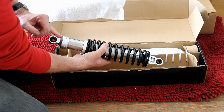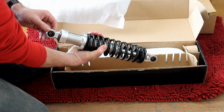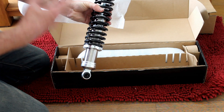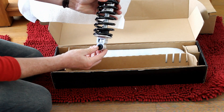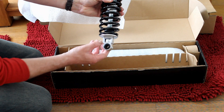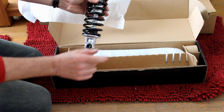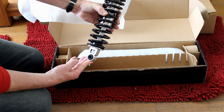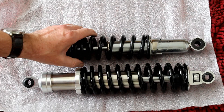The stainless steel spring in my case I had powder-coated black, the main core is also stainless steel, and these parts here are aluminium — you can choose what colour you want: black, red, blue, yellow, gold. I just went for simple anodized clear silver. One issue with them is they're quite fat — a lot fatter than a standard set of shocks. There was some discussion between me and the sales team; I actually ended up sending photographs of the bike and they said it looks like it'll fit but there may be an issue with clearance between this and your exhaust pipe. I said no problem because I can make a slightly longer spacer for the exhaust pipe if needed. Before putting them on the bike I wanted to compare them with the original YSS shocks.